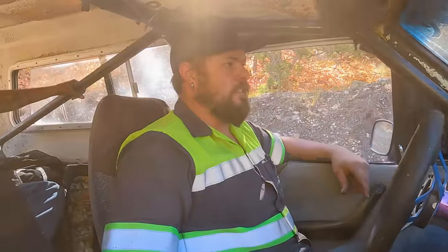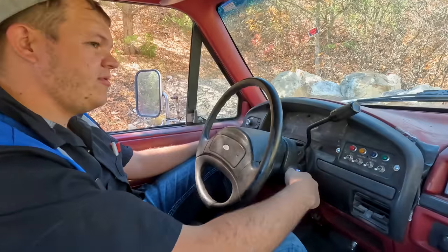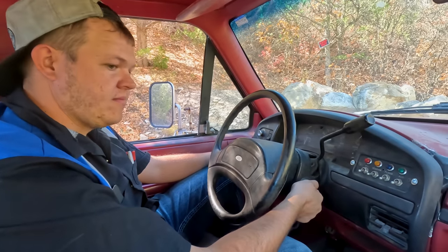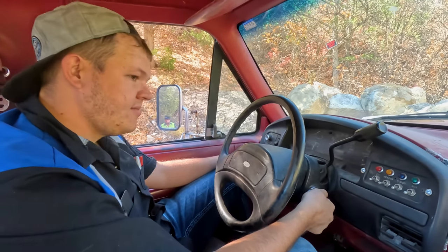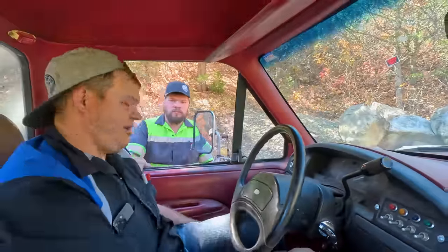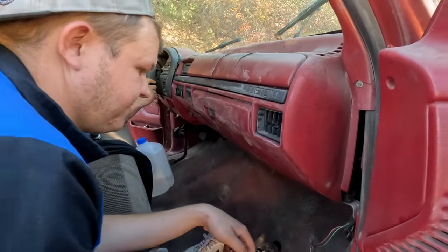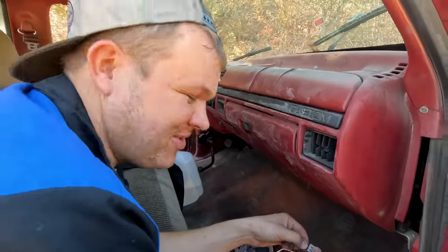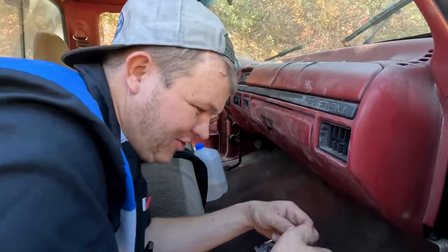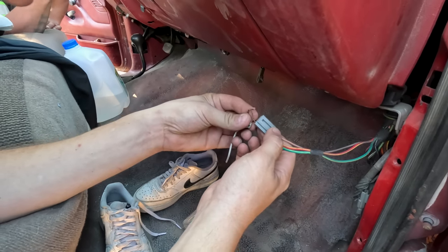Something happened to King Fred - he's dead in the water. Robbie's trying to start it and it won't start. No fuel pump. Did we just put in a new fuel pump? Did the switch come undone? Better check it because there's no fuel pump. Turn the key on - yep, that came undone. We just need our little jumper. Why don't we cut those wires and twist them together so it doesn't do it again? Out of everything we've done, we still haven't fixed this little switch.